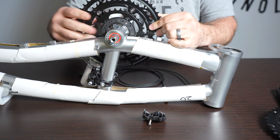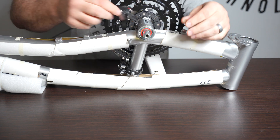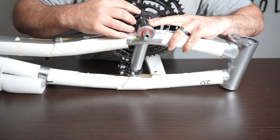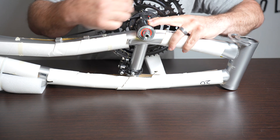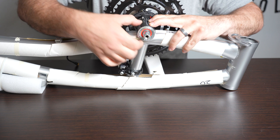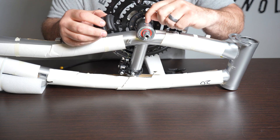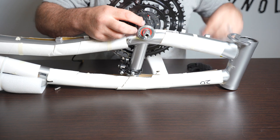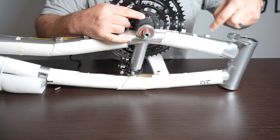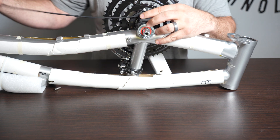Here's how to install one of these bottom bracket PAS sensors. As you can see, we already have the chain ring magnet installed — this would fit on the bottom bracket like this. You want to make sure the positioning of the sensor is within four millimeters from the magnets so it'll reach them. You can zip tie it in place around the brackets, or we do send you a channel guide, which involves drilling and tapping an M5 hole — the channel guides go over top and let cabling run through them. Make sure your cable is heading towards your controller.